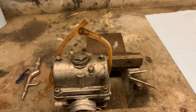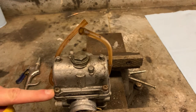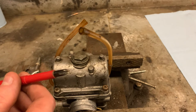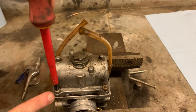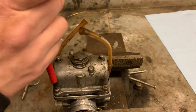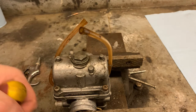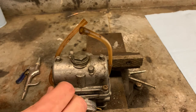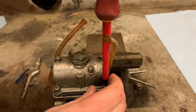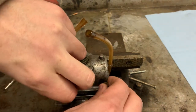I'm going to try to show you right in front of you — not sure how the angle is going to work out. Essentially you got to break these screws free to get the bowl off. There are four Phillips screws, so make sure you're using a good screwdriver that's the right size so you don't strip them. I already got these broke free ahead of time. Put a lot of pressure and twist them off. If any are stripped, I'd advise using vise grips to break them free. I'm going to go ahead now and take off these screws.